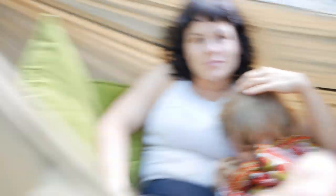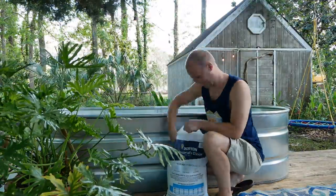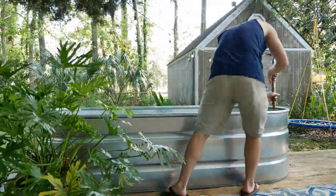Alright so I just got back with the salt and everything has been working fine in the pool. Val put this little pool float up and Nova had a lot of fun playing in there and got really cold. Now she is sleeping, and I use this online saltwater pool calculator to figure out that I need about eight pounds of salt for this 250 to 300 gallons of water that's in there. That turns out to be 13 cups, so I'm gonna measure 13 cups and sprinkle it in the pool. I'm gonna let that run for 24 hours once that salt has all been dissolved — the chlorinator will start turning the salt into chlorine, which is pretty amazing. Hang around for a couple more minutes and see that everything works.